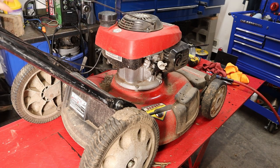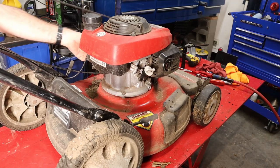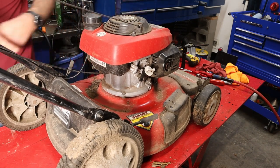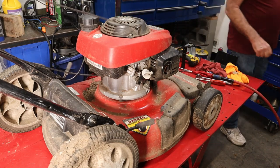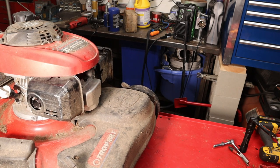Chokey dokey to chokey — pull the rope. Oh, got to turn the gas back on. The spark plug — that's going to have a lot to do with it. Alright, now then she'll probably go. Well, that's everything for the engine. What we've got to do is grease the wheels and lube the cables too, especially the blade brake cable — it seems a little notchy. Thanks for watching. This mower, outside of a good power washing, is ready to go.